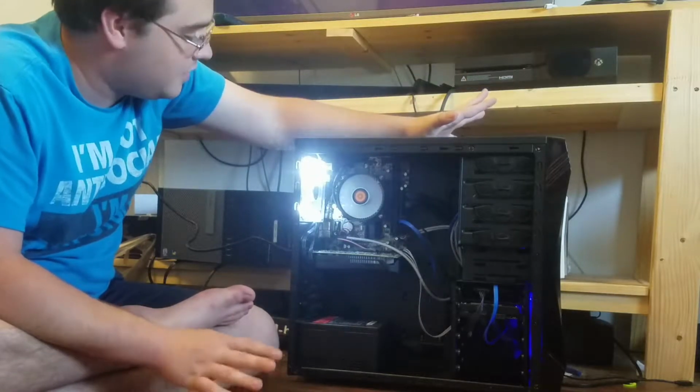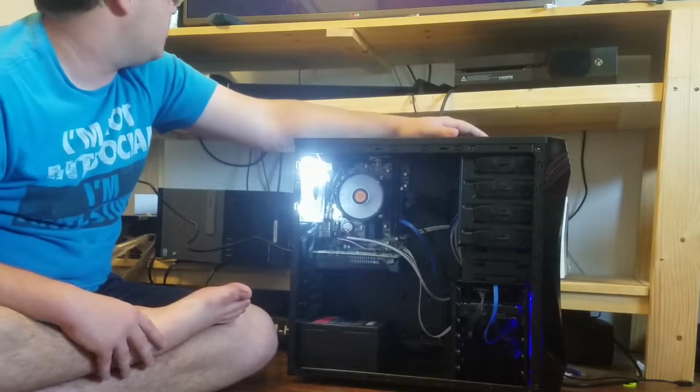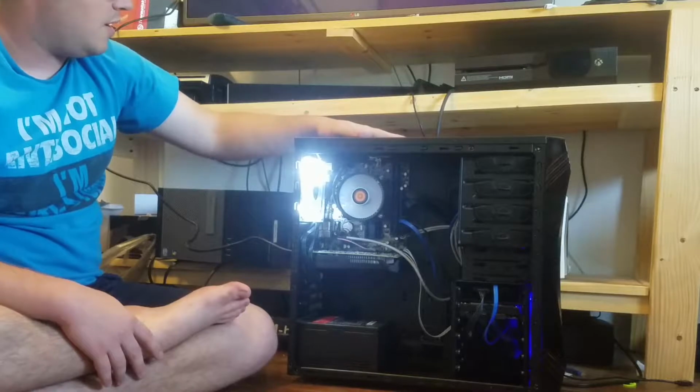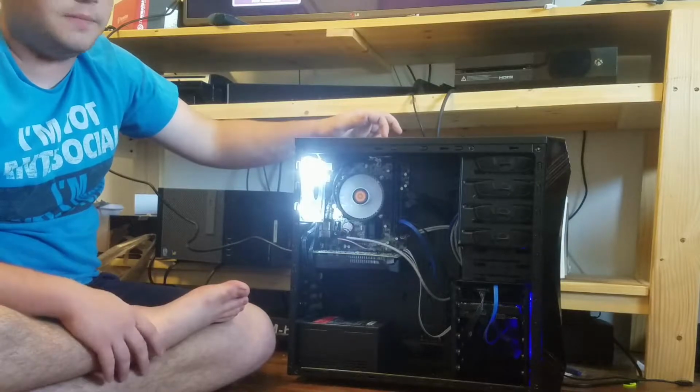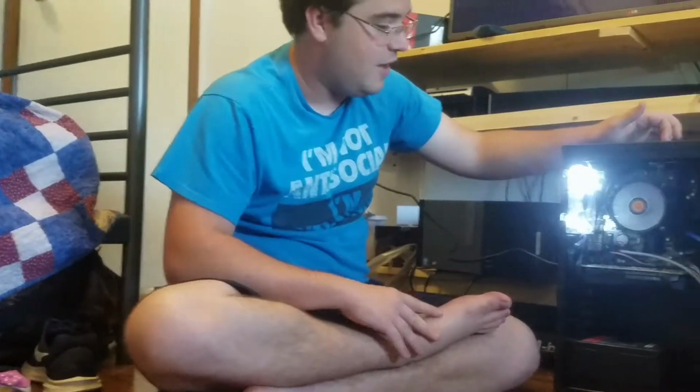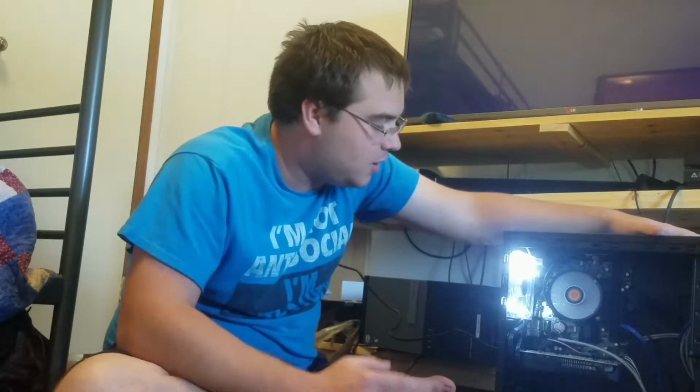It looks pretty good. It does pretty good. It seems like it boots way faster than this other computer over here. And so I do have a few other things to tell you guys about before we finish this off. I wish I had this on camera, but it would have taken 2 hours before I finally figured it out. But basically, every time I turned on the computer, I had it plugged into a monitor, and every time I tried to turn on the computer, I would get a beep, and then 5 beeps in rapid succession. And I'm like, okay, something's wrong.